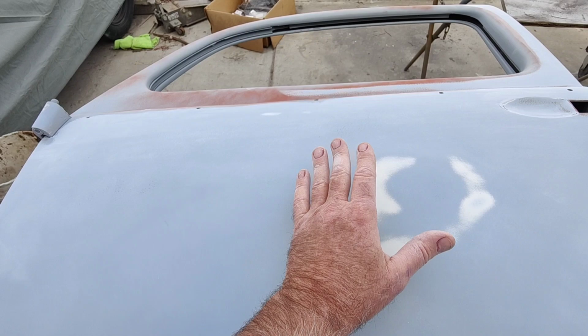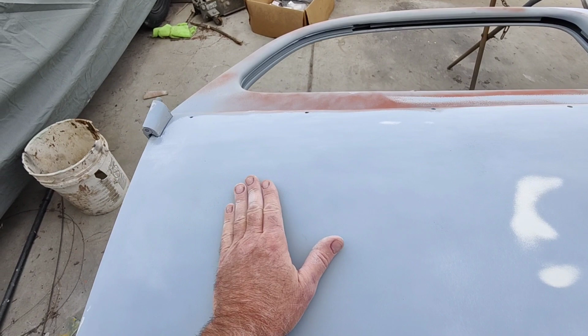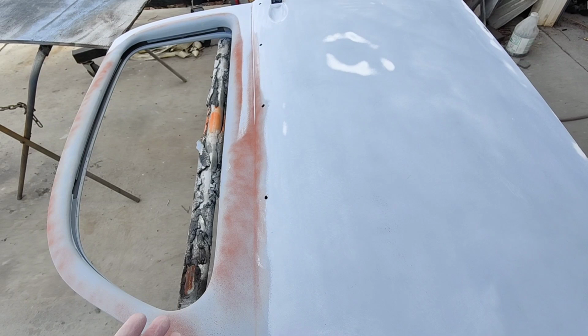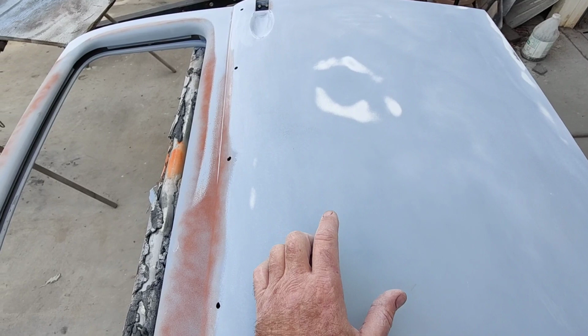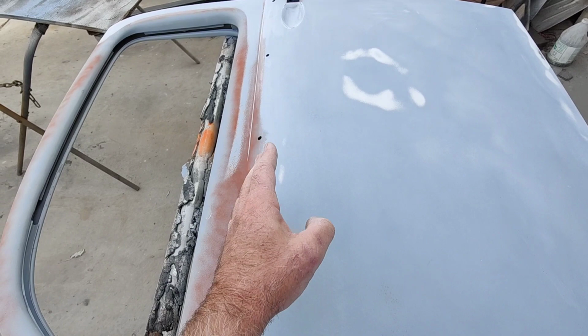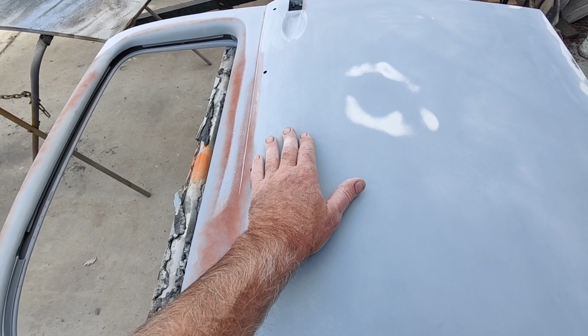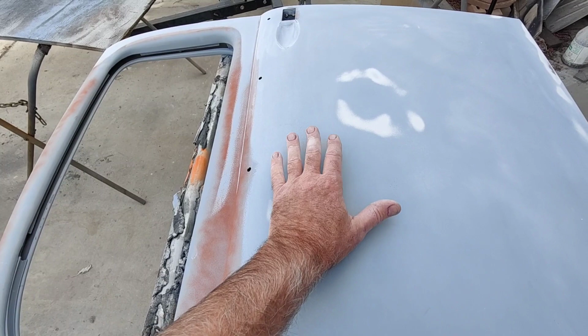So yeah, there's a lot of weird talk about things like that. All of it works. The problems you hear about sometimes are from the people that say it cracks or it absorbs moisture. Anything absorbs moisture when it's sanded, but before it's sanded, a lot of times the surface can be completely sealed. I've had polyester primer outside in the weather for months, and I sanded it all the way off, and it didn't go through to the metal, it didn't rust anything underneath. It's because it was never sanded. Once it's sanded, it's open. Then once it's open, anything can absorb moisture.